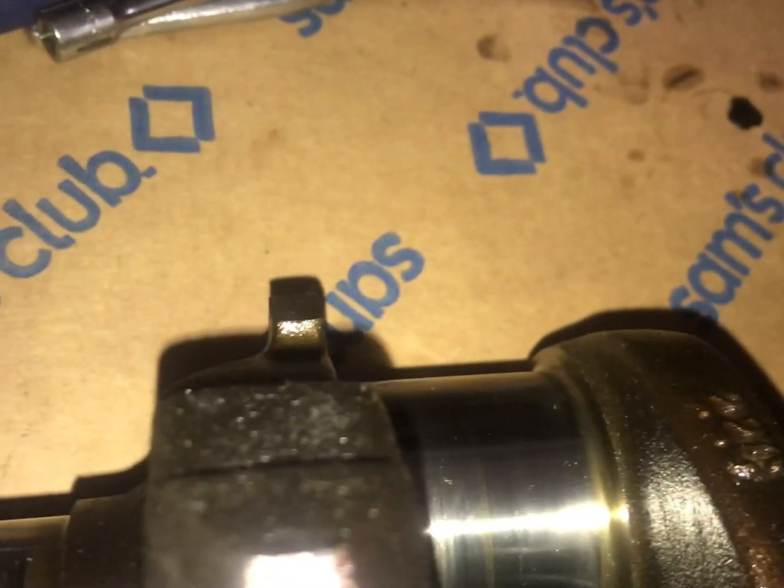Yeah, just over here real quick. It didn't look too bad. As you can see, some of these got hammered pretty good. I think the one that was really missing a lot was the... Is that the Ford one? No, it's not. Oh, I think we took them out of the Ford piston. Yep, there's the Ford piston. Ford 5.0. Crank journals look really good. Very minimal wear. Nothing I can feel with my fingernail. Just because I've got OCD when it comes to that, I might polish that with sandpaper, but I'll tell you what, those look pretty darn good.